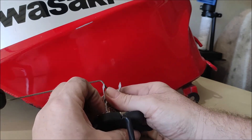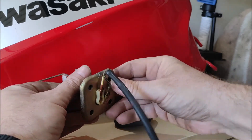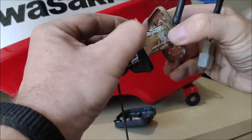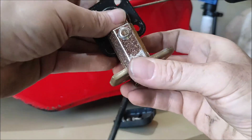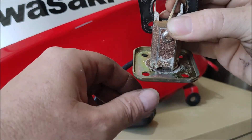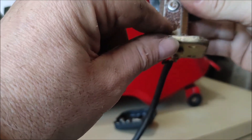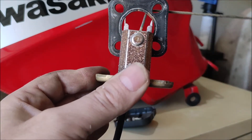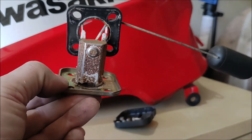The problem is this thing sits in fuel all the time. Sometimes these bikes have been sitting in a shed for months so they dry out. The connections are usually okay — the problem is inside. This casing rusts away and after a while there's a hole, and if you give it a shake you can see all the rust coming out. The whole potentiometer inside basically breaks down and rusts over, so it doesn't give a decent reading anymore. You can sometimes hear it scraping and churning.